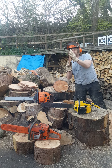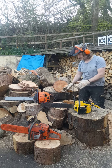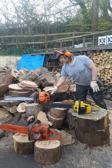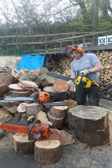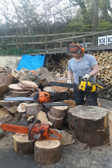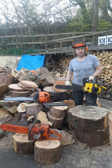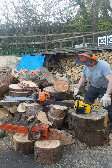I was trying to go slightly too thin and just shaved the edge off that disc, but it's much closer in terms of time and performance. Still, the L65 is an amazing cutting machine for its age — up to 46 years old and it just annihilates wood. That's a fairer comparison now. The chain is sharp and the rakers are set really well, and she does cut really progressively and cleanly. But that extra horsepower is really noticeable — I'd say the L65 was still two, three, maybe four seconds quicker on that one disc, but miles better performance from the 1010 this second time round.